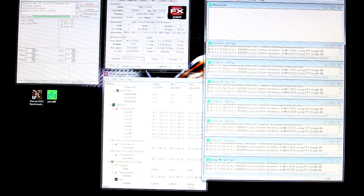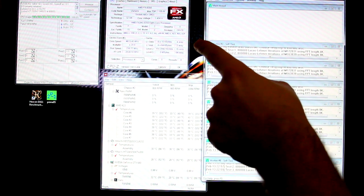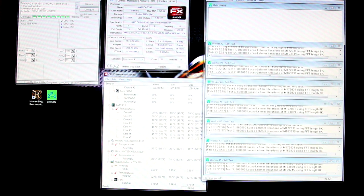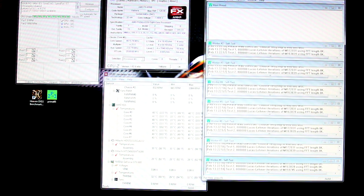The test has been running for a little while and everything seems perfectly stable. Take a look at how the temperatures have changed over just a couple of millivolts — we're running at 1.404 volts and we've gained 4 degrees Celsius on the core and a few degrees on the socket. That's why adequate cooling is so important. We just jumped up to 40 for a minute — and this is going to continue to go up as we increase voltage, so cooling is so important I can't emphasize it enough. Now let's bump the front side bus up a little more since we've got a stable voltage, and keep repeating this process until adding voltage no longer helps — then back it off until it's stable, and that is your max overclock.